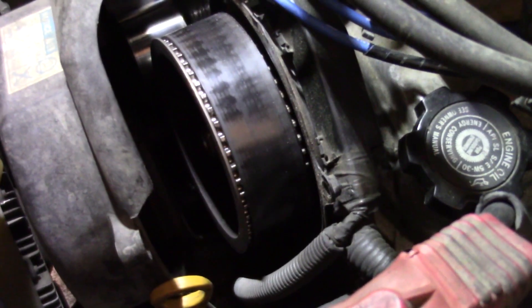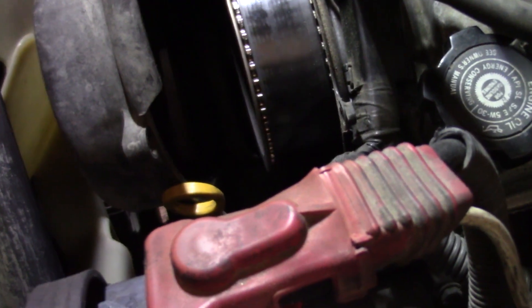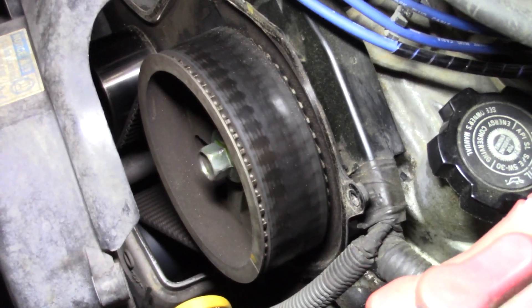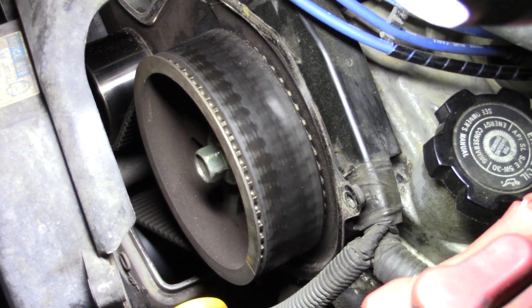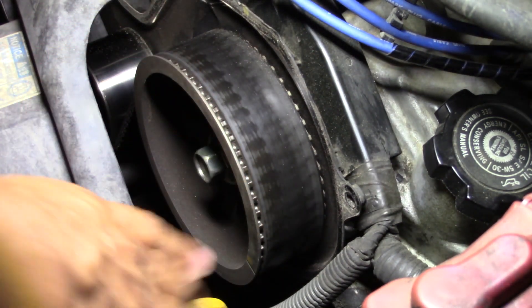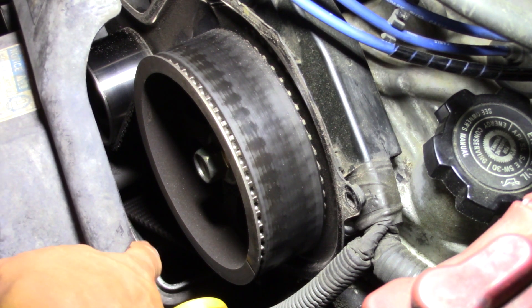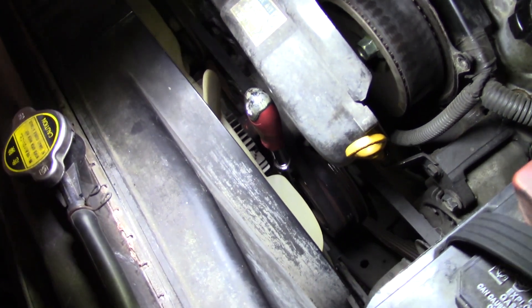As you can see, you gain pretty good access to the timing belt and can visually see pretty much the whole surface of the belt, especially as you rotate the engine. In my case, I'm actually about to change the timing belt, but I want to go on a road trip first and don't have time to change it beforehand. So I want to pop open the timing belt cover and do a visual inspection just to make sure there are no emergency scenarios — like a broken or frayed belt.